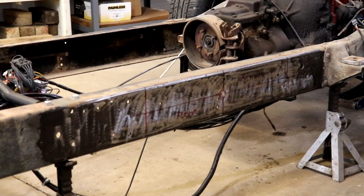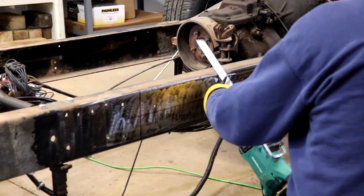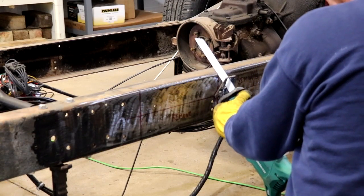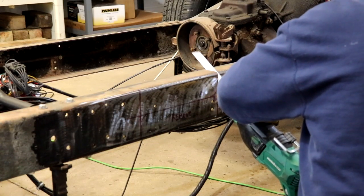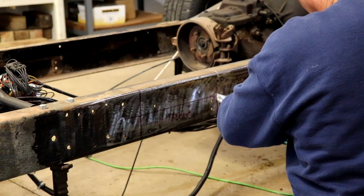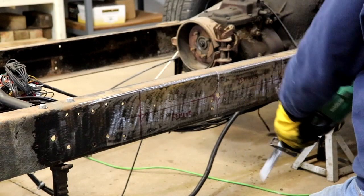Now, the way that I do this, I make three vertical lines 12 inches apart. If the whole thing is about 24 together, then you take the top of the frame and go halfway down and make a horizontal line. Once you do that, your first cut is the center line all the way through. The other two cuts will only be halfway, and you'll see how I do that in a second. If you do this correctly and you are properly supported, you won't have a single blade bind or any problem at all getting this cut.